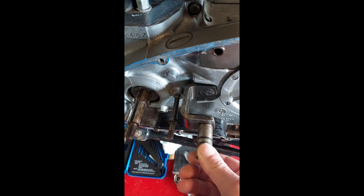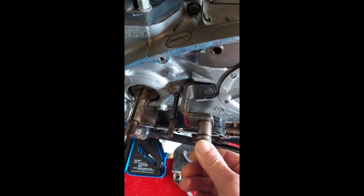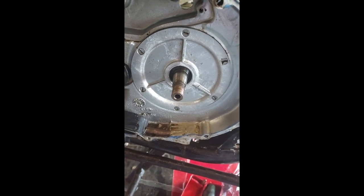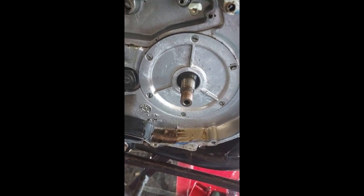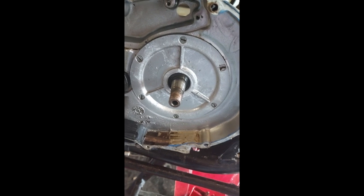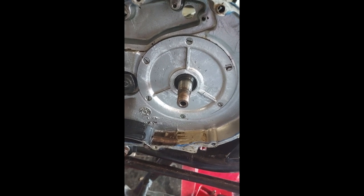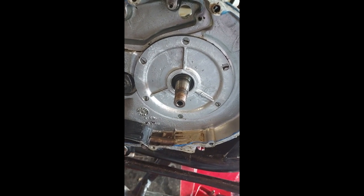There are proper pullers for pulling both the clutch basket and crankshaft sprocket off, so it's best to get the proper kit. The gearbox crossover shaft pulls in and out and you can feel there's a keyway that latches in and positions it correctly. Next I need to remove the chain tensioner to get at the breather holes behind it. I'm going to have to take that circular backing plate off the back of the primary chain case - there are slot-head screws and they're not moving, so it's probably going to be an impact driver job. I hope I don't have to drill them out.